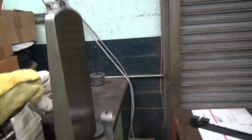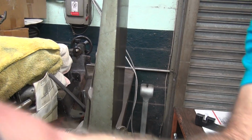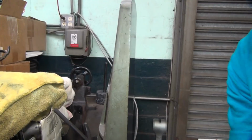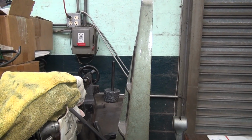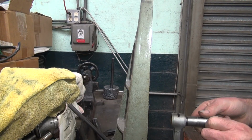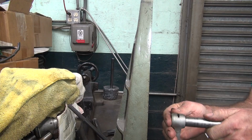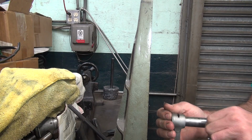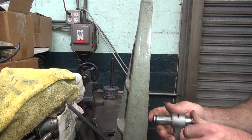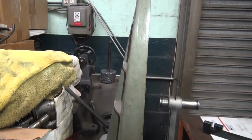So, it'll be real close. All right, we're going to check this line right here. So you put your wrist pin in the hole. The racing fit doesn't fit very well. If I burnish it in like this, maybe it'll fit. There we go. I'm breaking it in, see? High spot's gone, look at that. See, instead of honing it, we just burnish it.